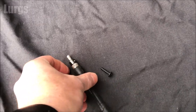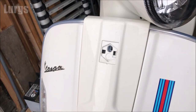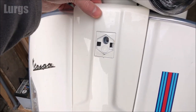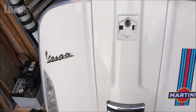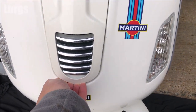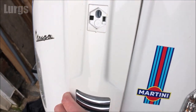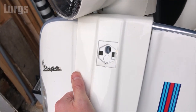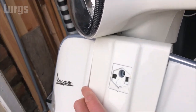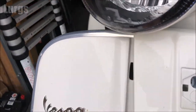What we need to do now is lift this fairing upwards and outwards. This is easier to remove if you turn the handlebars completely to one side, and it might help if you turn it to the other side as well just as you wiggle it — you're lifting upwards and towards you. It's just got four little clips, two on either side. Just be gentle, don't be too aggressive, you don't want to snap those clips.